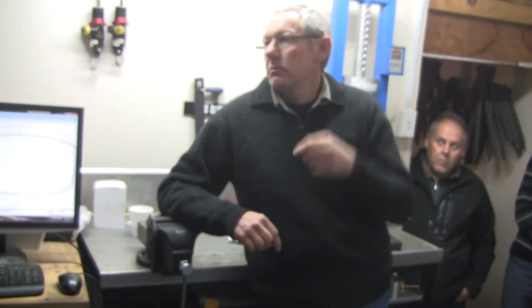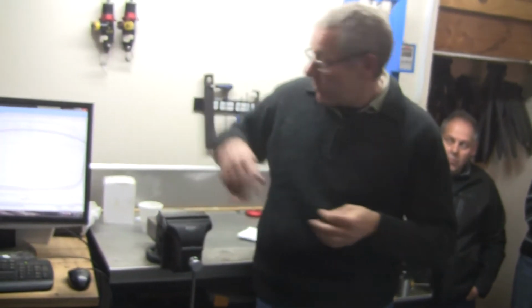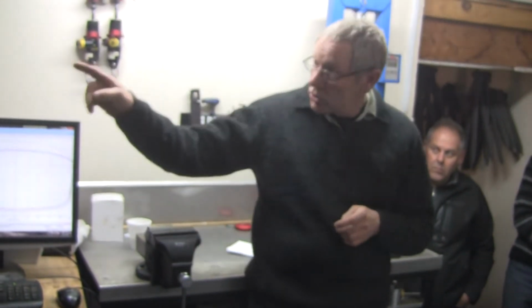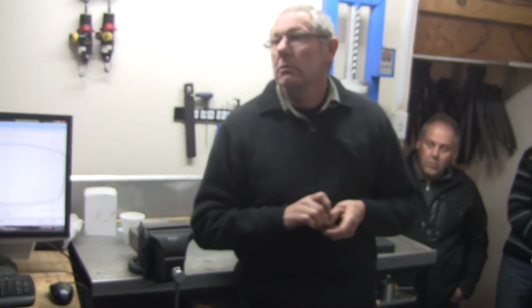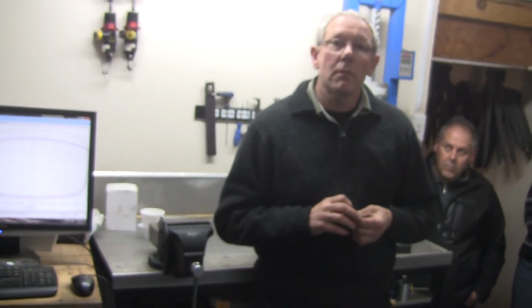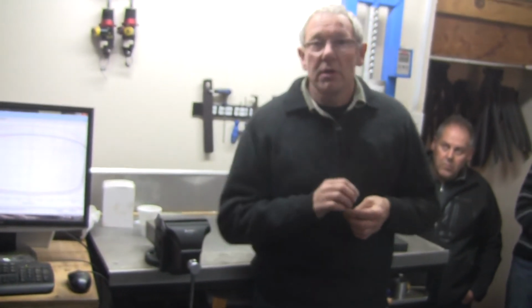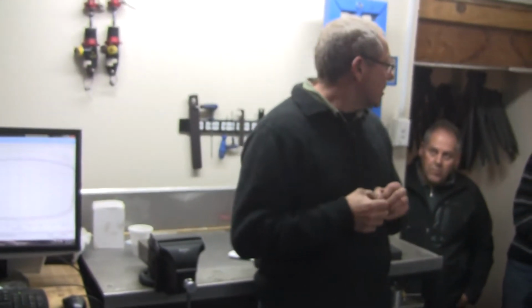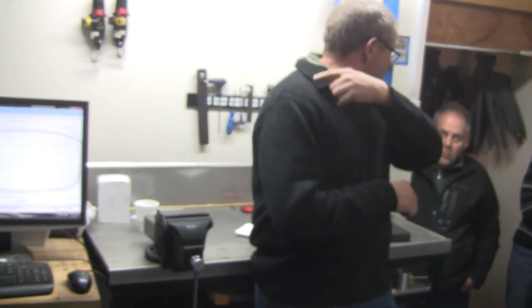But we're talking about a mechanical thing with oil flowing up and down in it and little flapper valves and things. We've got a set of shocks here, and they ran in the championship 2 years ago quite successfully, and that's one of the shocks, but it's the first time we've checked it today. Been sitting here for a week or two to be checked. So what the other ones are like, I don't know. We haven't checked. Might be perfectly good. This could be the best one, I don't know. Could be the worst one. But I think we've probably demonstrated that there's certainly some vagaries in what you think you're doing and what is actually fact.